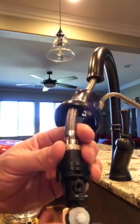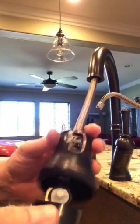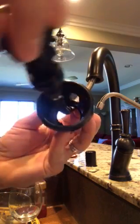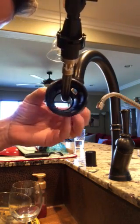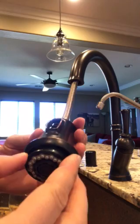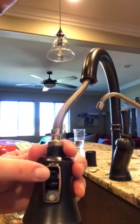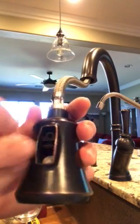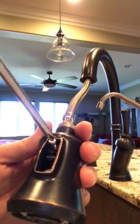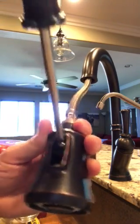And then you slide the housing back over it, and it lines up with these, there's grooves inside here. If you can see them or not. There's grooves inside this housing that line up with the head itself. It goes right back in, only goes in one way, pops over, and when that hole where you put that little plastic piece lines up with the hole again, you're ready to put the screw back in. You put the screw in. Tighten it down. You know, it only has to be finger tight. It's not holding in any pressure.